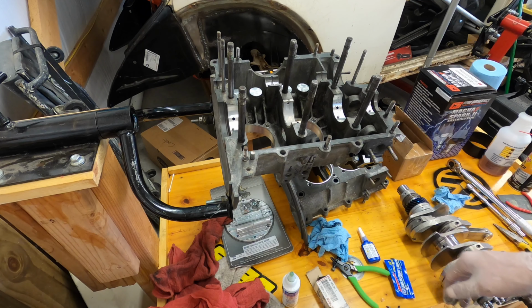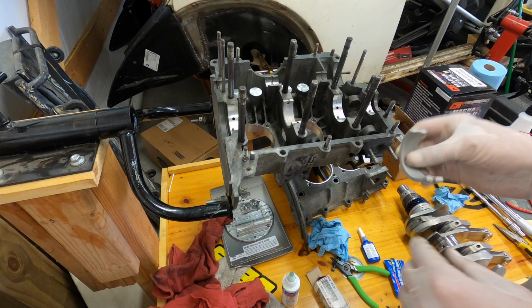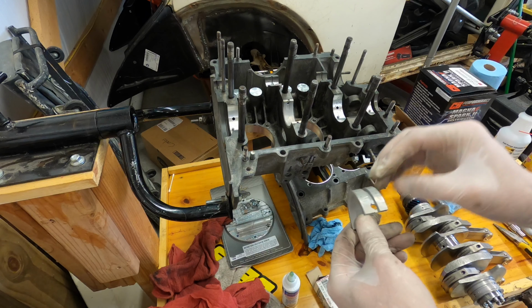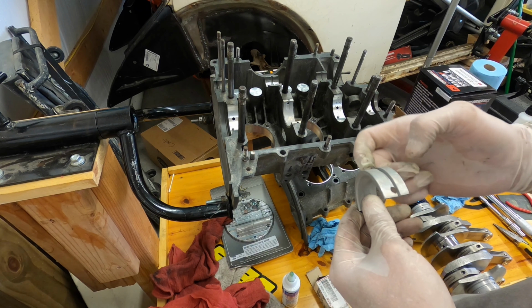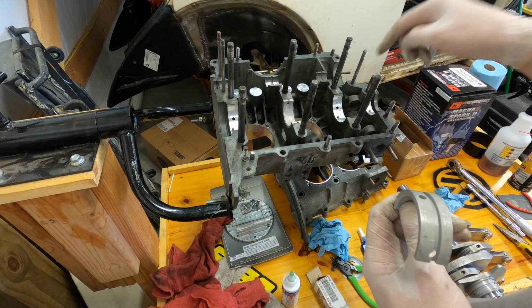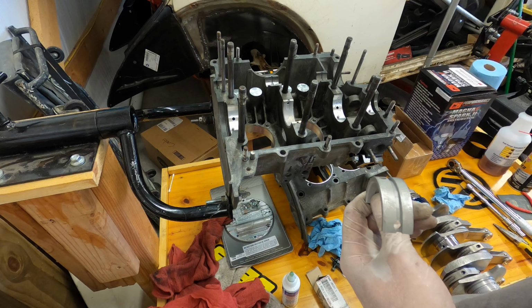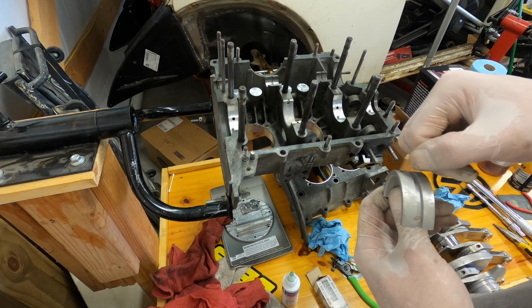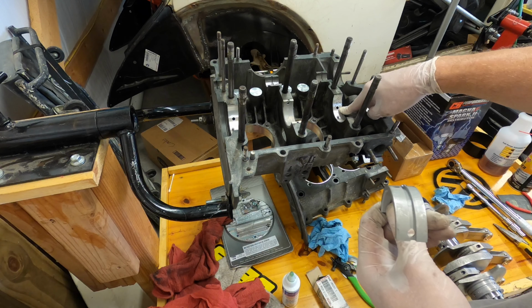Something else you want to look for with the bearings. I've seen some aluminum blocks, the aftermarket stuff, that worry, you have your dowel pin on towards the flywheel, but the actual oil galley hole was not in line with here. And I've seen them mark where the oil galley was and rough it, take a Dremel with a bit on there and open up that spot so that the oil would go into the galley right here from the oil galley hole.